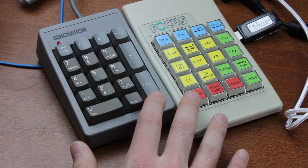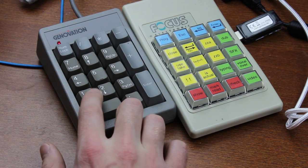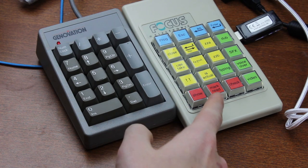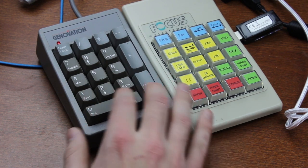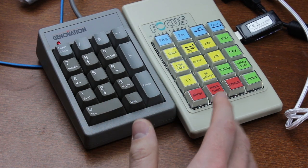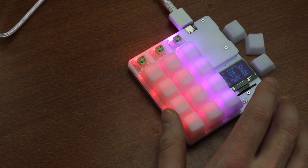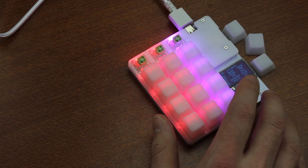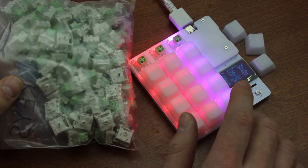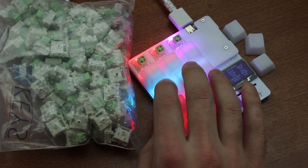These two have different but both very tactile clicky Alps clones in them. This one originally had something softer but I swapped them for some T5 clones because I found I really like the massive tactility on the switches that came with the other one. Essentially I want them to be as clicky and tactile as possible, so I took the Gateron green switches that came with the ducky pad by default and threw them away. When you say MX-compatible clicky ultra-tactile switches, the answer is box jades or navies — so I put a bunch of jades in and I don't regret the decision; these switches are perfect for the job.